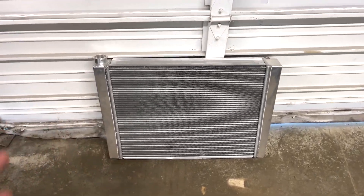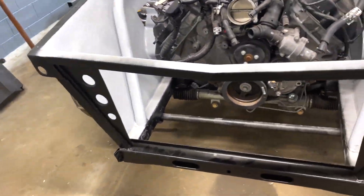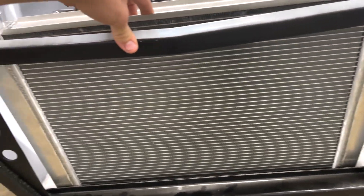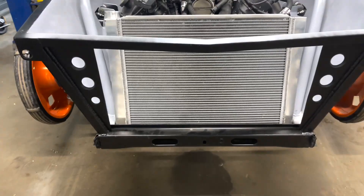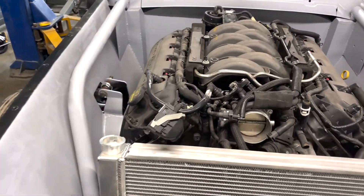Here's the radiator we are going to go with, and this is probably the biggest radiator you can possibly fit in between these frame rails. I measured it up and found the biggest one — check out how big that opening is. On the factory car the opening for the radiator is much smaller, which would remove a lot of airflow. This is a huge Coyote engine and we want to get this car cooled down properly; if your engine starts overheating you can possibly blow it up.